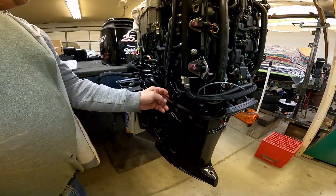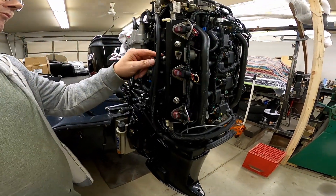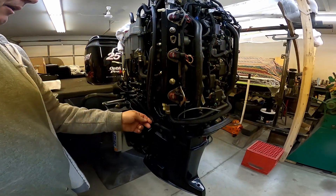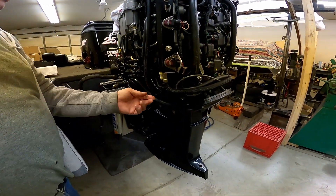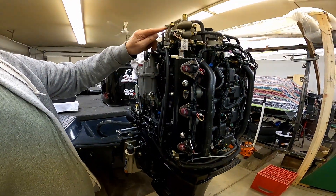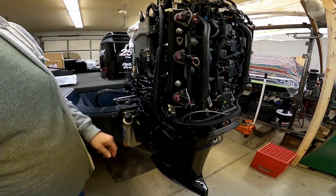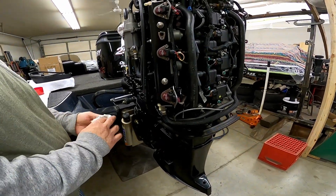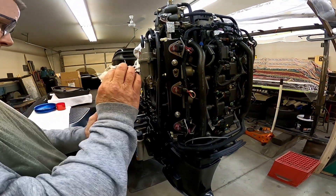This is the excess air — goes from the compressor into the air side of the rail, into the adapter plate. And this is the strainer, which supplies water to the compressor. This line, and behind here is a strainer that you need to pull out occasionally and clean her out, which is full of weeds and stuff. So that stuff has to come off.